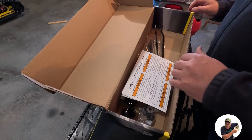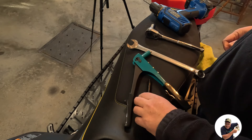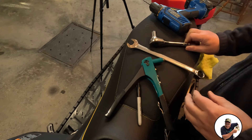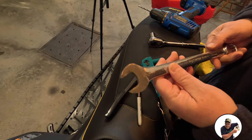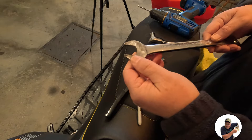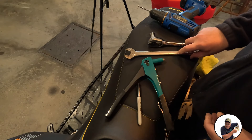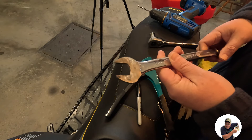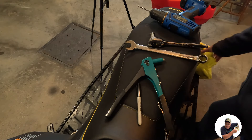You can install these on Gen 4 or Gen 5. Go to the BRP website, download the instructions with the model number. Now let's look at the stuff we're going to need. You will need a Sharpie for sure, you'll need a rivet gun, a ratchet with a number 16, your drill and a 13/64 drill bit, and a special tool from BRP. My buddy filed down a 22-millimeter wrench so it can fit in a specific slot. Ski-Doo does offer the actual tool for sale — I believe they want $50 for it — so my buddy just bought a nice wrench and ground it down.